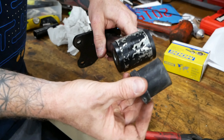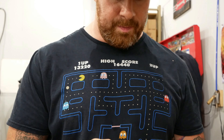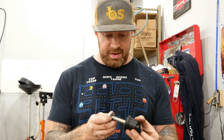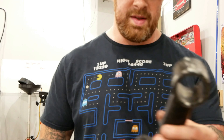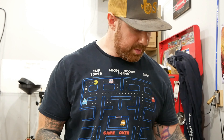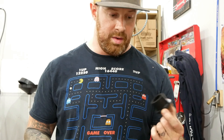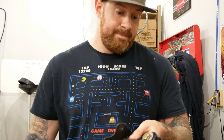On second thought, I think I'm going to trim these bushings down just like they are and just run the bolt through them. This isn't an actual leaf spring bushing setup — these are homemade motor mounts that I made myself. I think the bolt sitting in that rubber should be fine. If you know of a better source for a rubber bushing that fits into a sleeve like this, let me know, because these are Moog parts and the sleeve and poly bushings came from Amazon. Or if you know of a softer polyurethane bushing that will fit into a sleeve like that, also let me know. I'd love to try something softer. But in the meantime, I'm going to run these rubber bushings and just throw the bolt right through it.